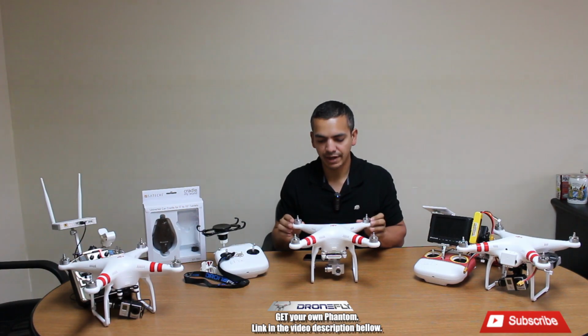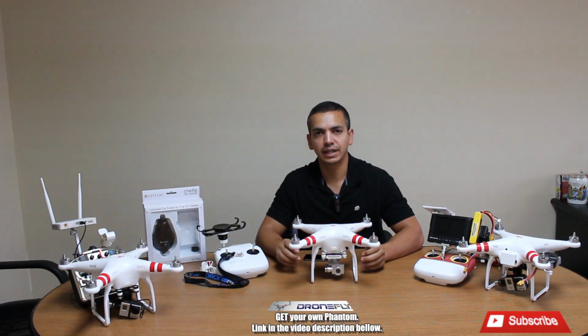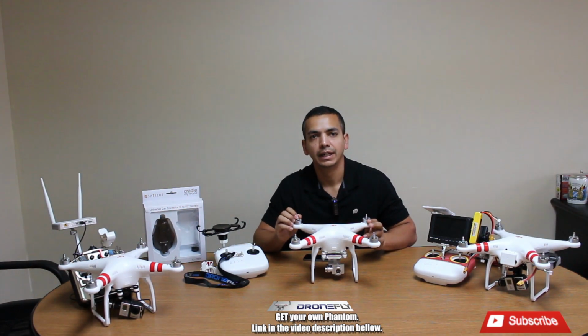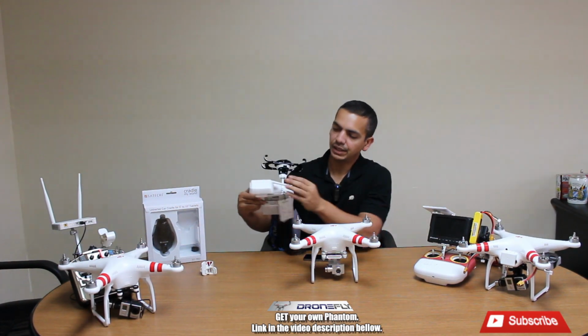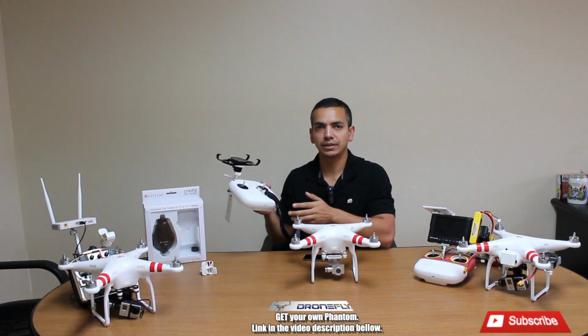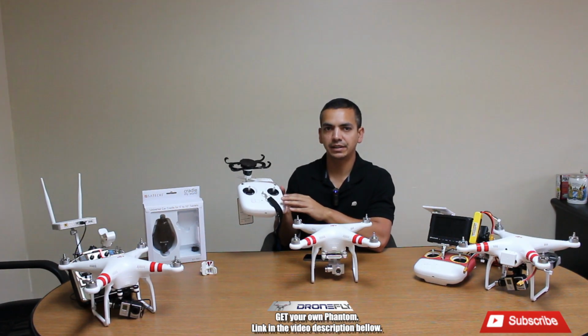Now back to explaining this Phantom Vision Plus. The FPV runs on Wi-Fi. Everything works nice and well with the application. The only downside to that is the range. But I'm gonna be putting in the video description a bunch of links that I've researched, where people are achieving close to 10,000, 15,000 feet, which is almost a 3-mile distance, by upgrading or putting antennas on the Wi-Fi repeater, and also changing the antenna on the remote control. As I explained to you guys in my last video, this remote that comes with the Vision is 5.8 gigahertz.